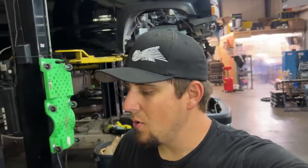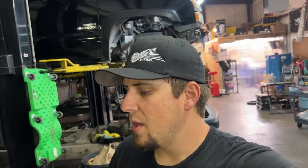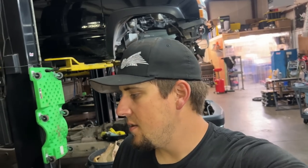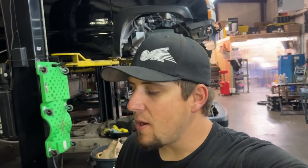That way you generally know where it blows once, it might do it again. So I don't know if that's a weak spot of the block, weak spot of the head. I don't know. I'm going to flip flop the head stud so the same one doesn't end up there. But basically we will put it all back together. I'm going to check and make sure everything's flat, obviously straight edge feeler gauges on both the head and the block. But yeah, no issues here. Just, you know, regular 2000 horsepower maintenance.